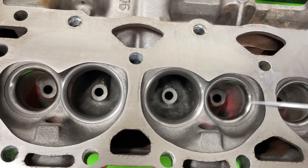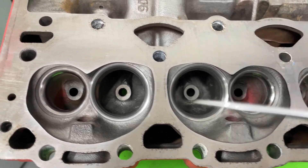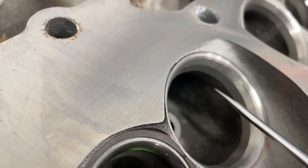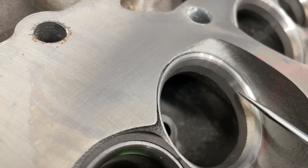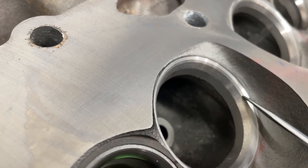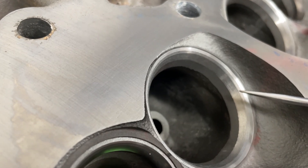So this is the head. You probably hear the term like five-angle valve job or three-angle valve job. Well, this one actually has three angles. He got it stock and we cut it with just a three-angle valve job, and it looks like there's four. So if you look — that'd be angle one, two, three, four. But really, the only ones that got cut were this one, this one, and this one. That's a 60, 45, and a 30 top cut. These are the most common angles you get just about anywhere — anybody's got this cutter. This isn't like a high-performance one.